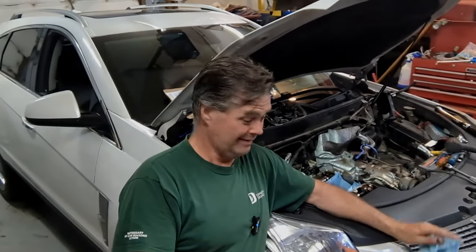You guys don't even know how much better I feel right now. Getting that out on the first crack — I was pretty confident I could get it welding, but the next step after that would have been pulling the head off, taking it to a shop to extract it, re-drilling a new hole, probably putting a helicoil in. I don't even want to think about what would have been needed if I couldn't get it out this way.